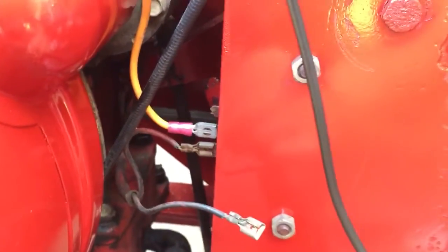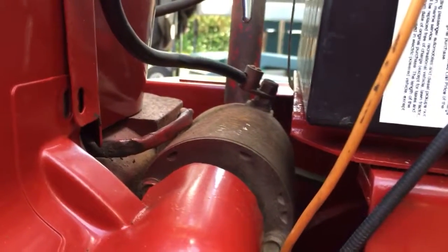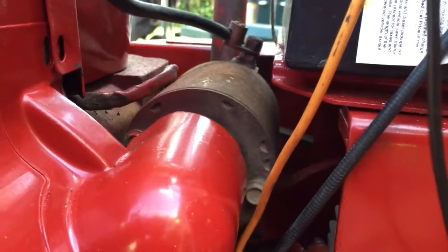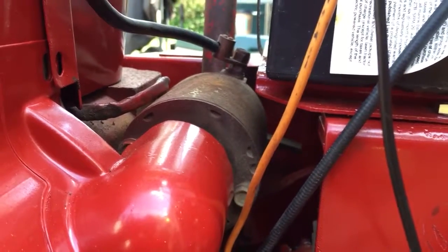So anyway, I don't know if that might be the problem. But I'm getting 12.57 volts basically to the starter. I think it might be the starter. But like I said, I'm not an electrical person, so I don't really know. Nothing's happening once the power gets to the starter — nothing happens.